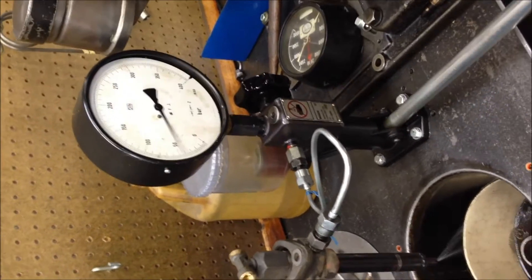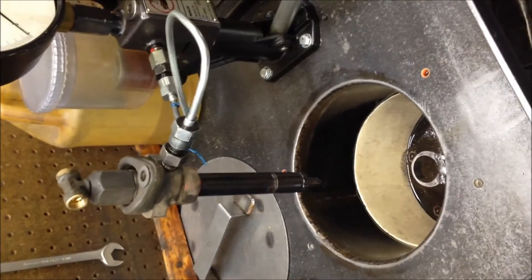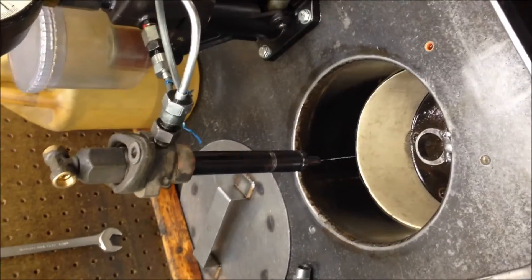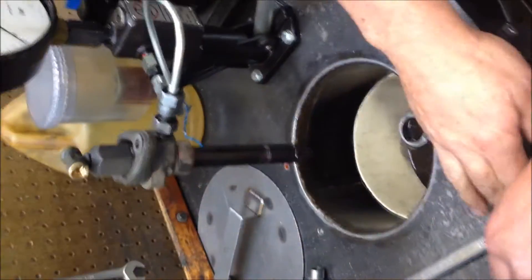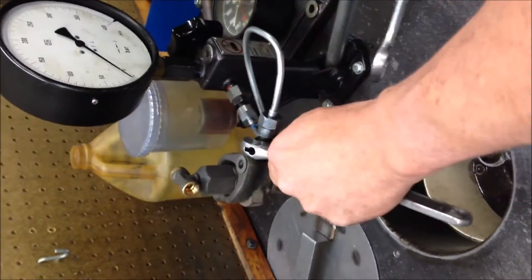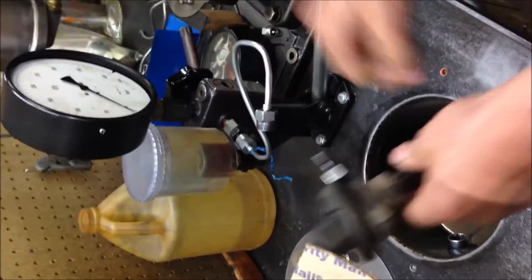Pressure is going to come up, but it's not even doing 60 bar, so the tips — that needle valve is stuck in there. So that's... yeah, you can see that's totally different than the others. It's not doing anything. Well, maybe my friend got sold a set of bum injectors. I think he did. Or they might be good — they've just been sat and varnished.